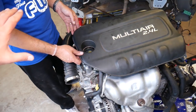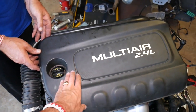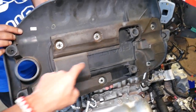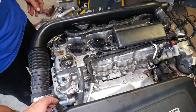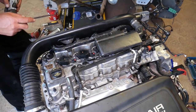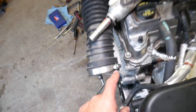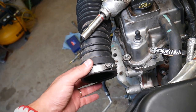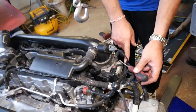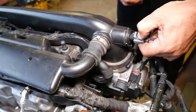If the engine is in the vehicle, when you open the hood, right here you'll have the air filter box. First, you need to remove your engine cover — just pull it straight up. There are four rubber bushings that attach to the valve cover. You can see the air filter box with the intake hose; get that hose clamp loose with a flathead screwdriver and pull the hose out. Do the same on the throttle body side. Then remove the intake air temperature sensor.